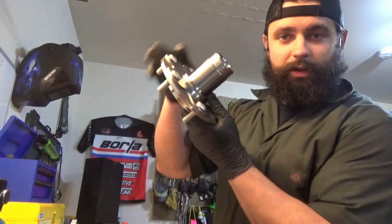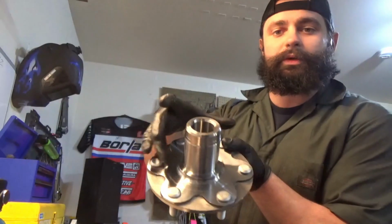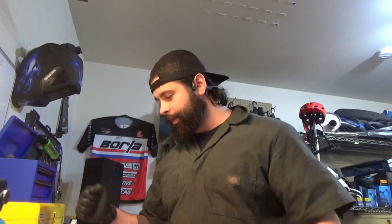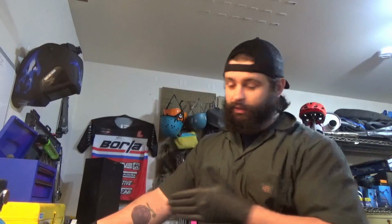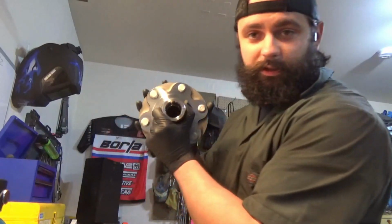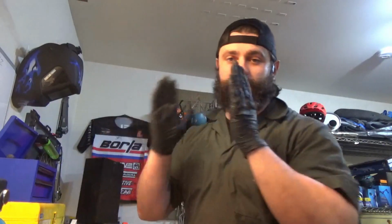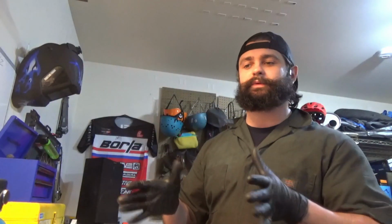Because the hub has this lip that sits beyond where the bearing is and where the knuckle is, it's kind of hard to raise up the knuckle enough and then have strong enough points for it to sit on and be able to push all of the force through the hub to get it out. So what I did was I cut the edges of the hub off, like here and here, basically getting me a straight shot at the knuckle. Then I was able to put it in there, jerry-rig a bunch of random bits of scrap and whatnot, and I was able to press it out.